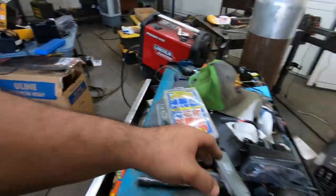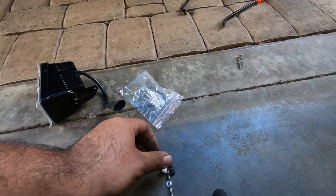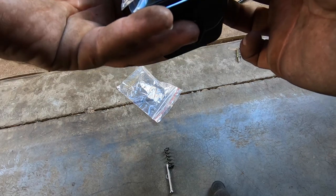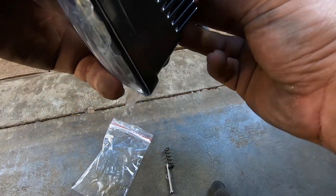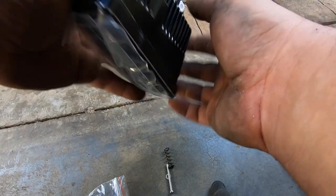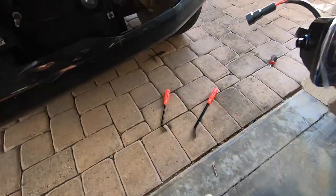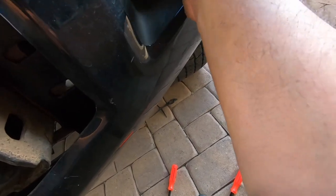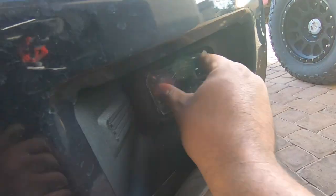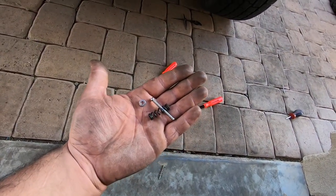For the new fog lights, there's really just one prep step. From the hardware bag, take the little white insert and install it from the bottom of the light. The label tells you which side it is — this one says left-hand side, which is the driver's side. Then just push the light into the bumper and it clips on, then install your hardware and you're done.